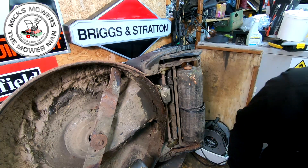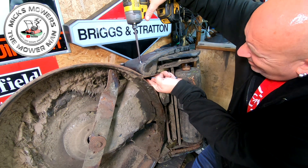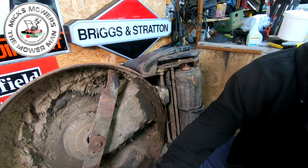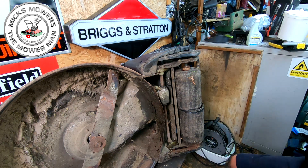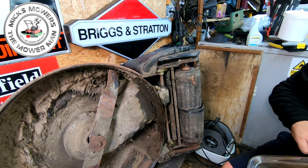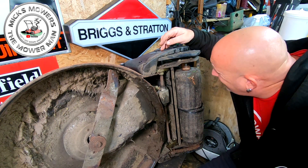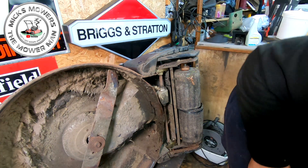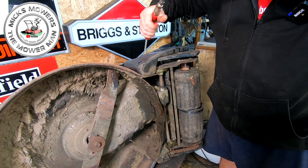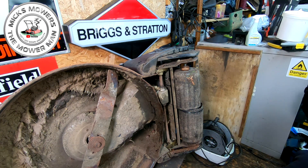So 8mm right up in here — it looks like an 8mm, it might even be a 6. On reverse — there you go, alright. That's going to drop. That comes out. The belt's actually come off of the pulley too. I'm going to need a magnet tray — that's 110% — there's going to be loads of bits and pieces coming off this. There's another one here somewhere which is going to be hidden. Phillips in there — so we're going from 8mm to Phillips. Let the games continue.